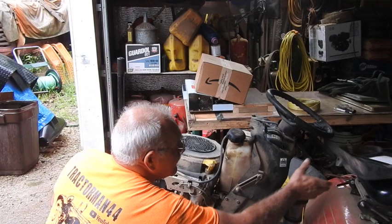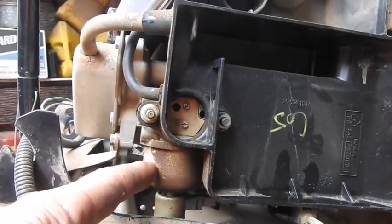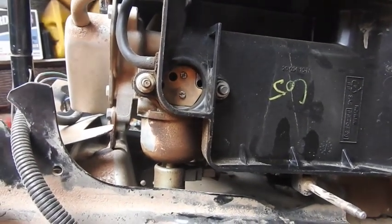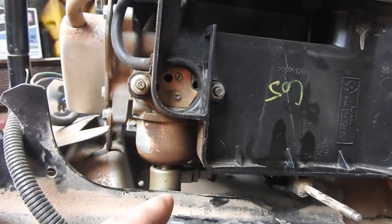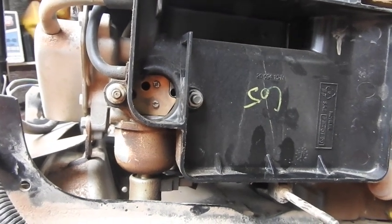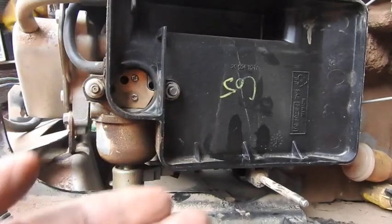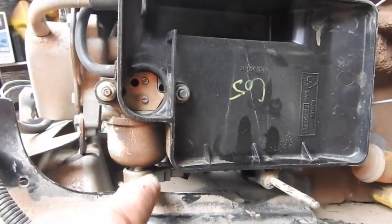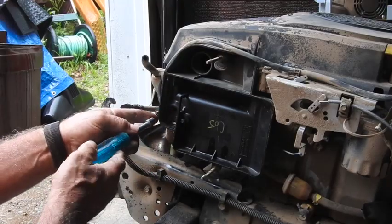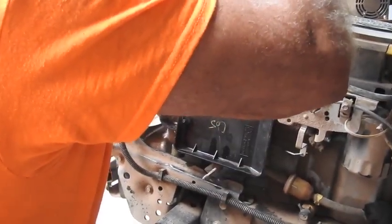Of course, check your filter for excessive dust. There's your carburetor bowl — that's where your float is, and on the very bottom is that funny-looking thing I was describing. That's your anti-backfire solenoid, and if you look, you can see wires coming right to it. Those wires will be energized the instant you turn the key on and de-energized the instant you turn it off. We need to remove these two 10-millimeter bolts off the carburetor, and a third one up here which is a 5/16ths or 8-millimeter, to remove that plastic from the front.